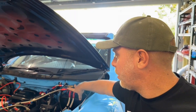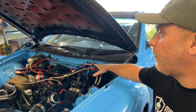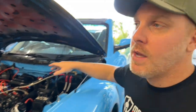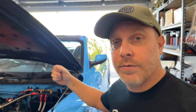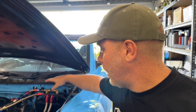The beauty about having the surge tank in the engine bay is that if something like that does happen, the fire is contained inside the engine bay, giving you a chance to grab a fire extinguisher and potentially save the car. In the boot scenario, you're more than likely going to either be killed or lose the car, because it'll be a lot harder to put that fire out once it takes hold of all the interior stuff in the back boot.